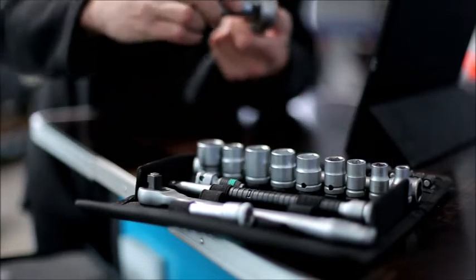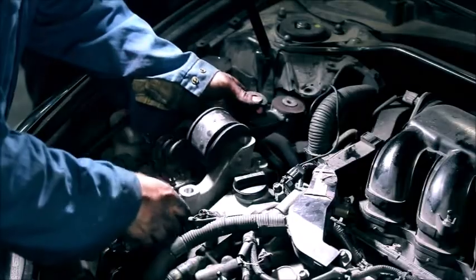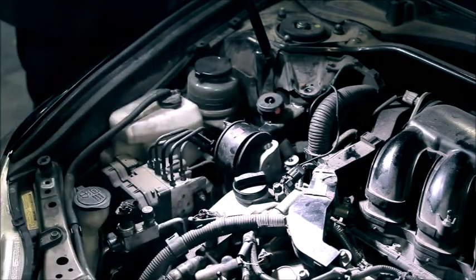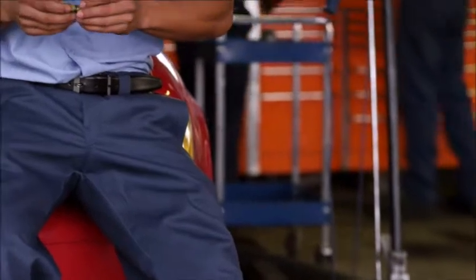Honda's going to tell you that they don't sell the gaskets if you have a spool valve leak, and if you have a leak, it can drip onto your, at least in one location, I think there are two spool valves. I don't know. Somebody tell me in the comments. But it can leak onto your alternator and kill it. So you definitely want to take care of this.